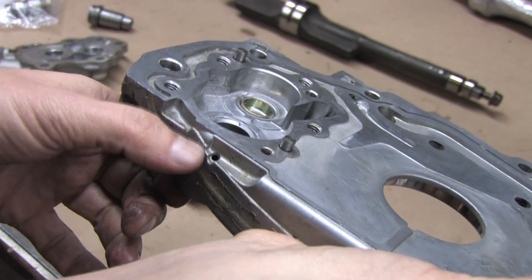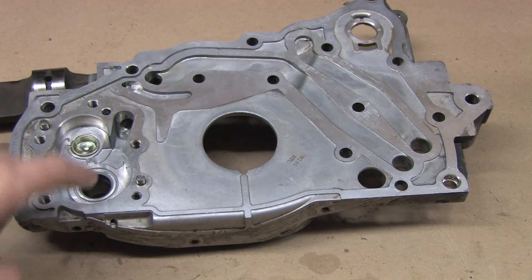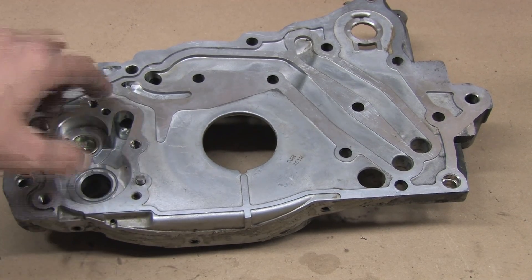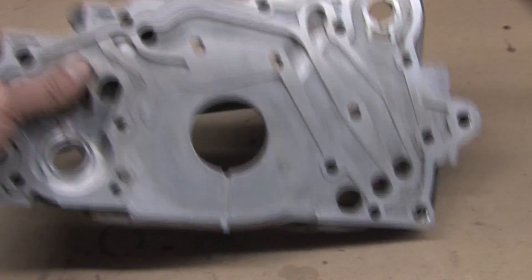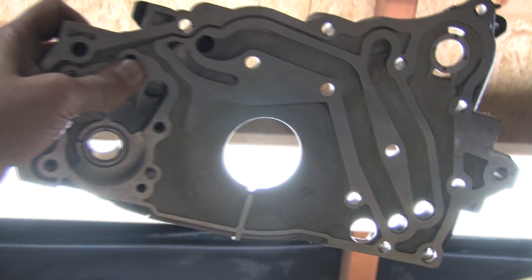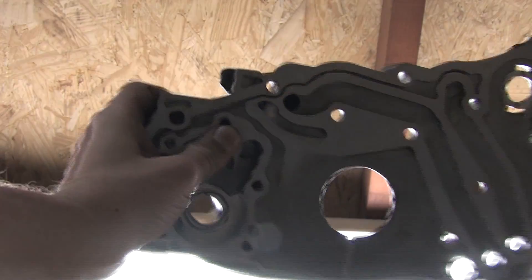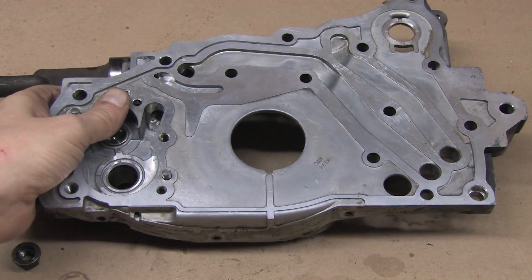This front casing sandwiches a complex routing of fluids between it and the block. Both the block and the front case have to match up in order for your oil system to work properly — it has to be torqued down properly to maintain oil pressures and flow without leaking. It's a precision cut slab of Swiss cheese. All of the DIY guys tend to make changes to things inside their engine with a different set of goals, and many of these modifications affect the oil system. It's important to note which components need how much oil and when they get it.